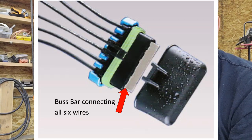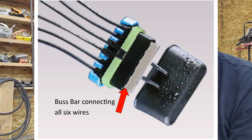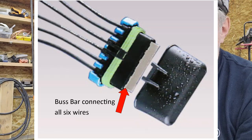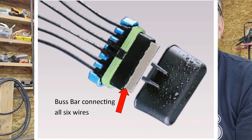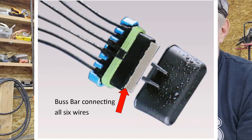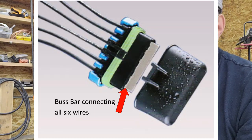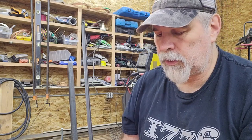So for instance, as an example, let's say you wanted to have 5 clearance lights and you only had 1 brown wire. You would insert the 1 brown wire as the source, and then you could have 4 more branch wires going out. They all go into that connector. And then on the top side of the connector, there's just a bus bar. There's a little lid that snaps in to seal it off. And inside that lid, there's a bus bar that buses all of those together. So you can have 1 source wire with as many outputs as you need. Again, there's silicone seals on all the connections. So that's another good way to do the same function as a Scotch lock, other than it's more versatile because you can have multiple outlets and it is 100% sealed.